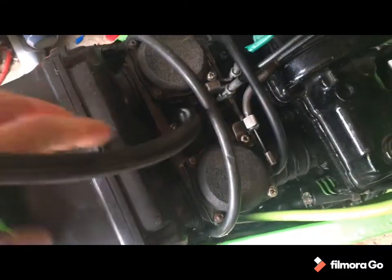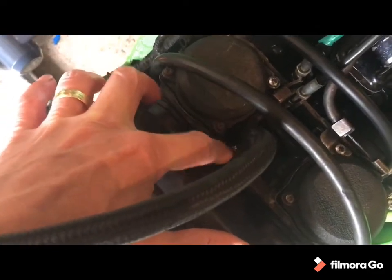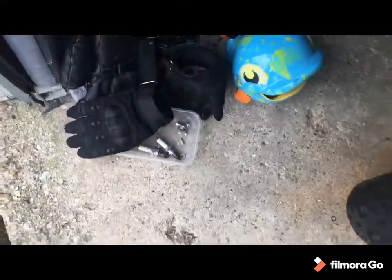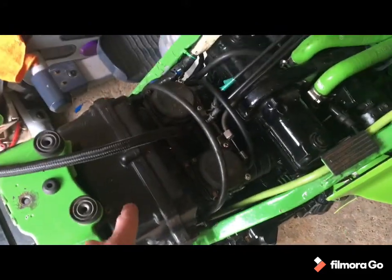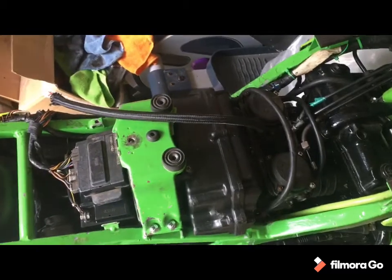I've also routed it up around the back of, and I think I'll actually save a little bit when I put this back together. I'm going to run it through here. Can't quite see my bodge repair, so there is a Jubilee clip on that, just taking it off. Right. I'll put it in with bits and pieces. So carry on stripping down, side bits off, airbox off, carb out, and then I'll probably do the rest indoors because it's warmer. It's a bit chilly today.